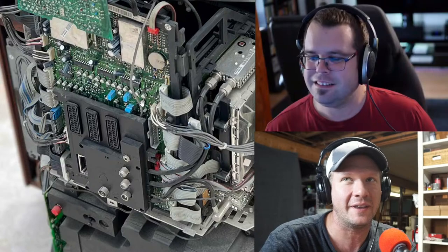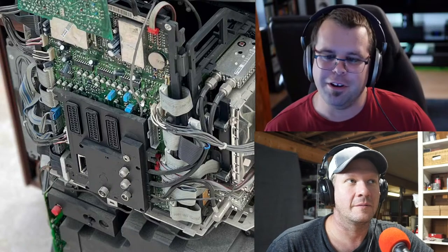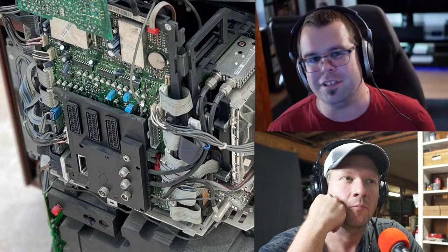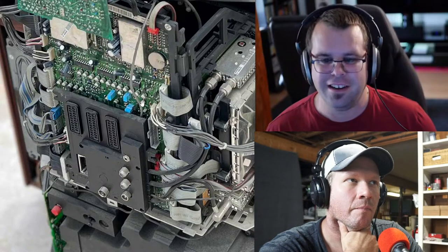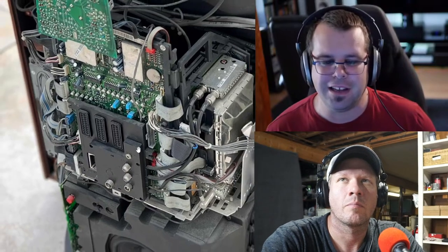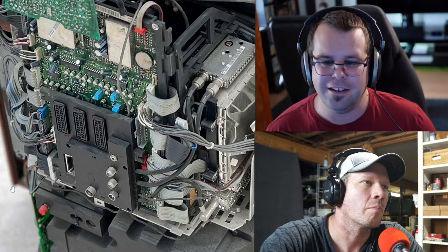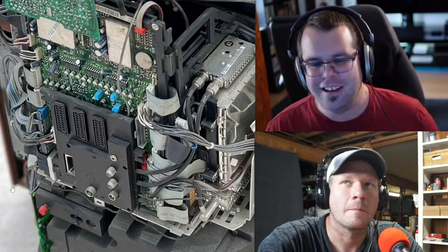Every other B&O TV that I've ever seen has a battery in it, all the way back to the 80s ones. Yep. And what's cool is that obviously this means the CDI components are integrated directly into all these different boards that B&O built. So it's a completely bespoke solution to the CDI, right? They're not just using some off-the-shelf Philips board. It's a real unique design, which I thought was awesome. And from looking over the board myself, the quality of the capacitors they're using seems significantly higher than those in a normal Philips CDI. There's some pretty decent components in there, which, as it should be. It's an expensive TV, right? Right. But so that was awesome.